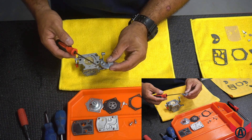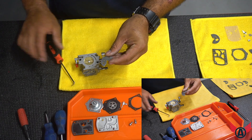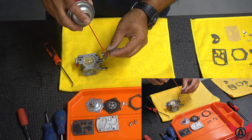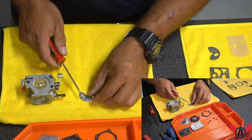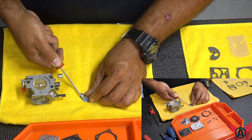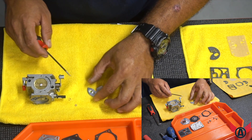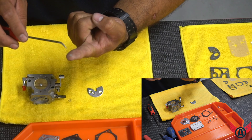In the case of the filter, if you want to clean it, you can see the circlip with the filter and clean it from the backside. Just be aware that any particles that can be invisible to the eye may be residing in there. To remove the filter, basically take the circlip off and the filter will simply pop out from the back. Just be careful — it's the smallest filter in the carburetor on this kit.